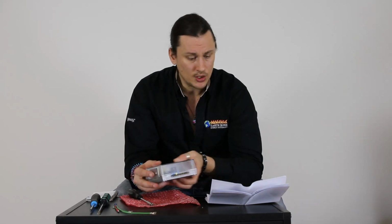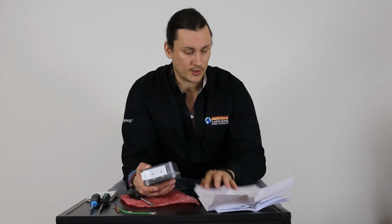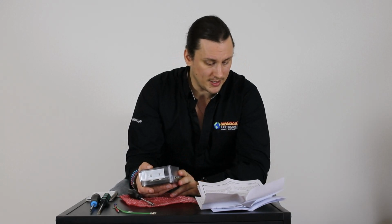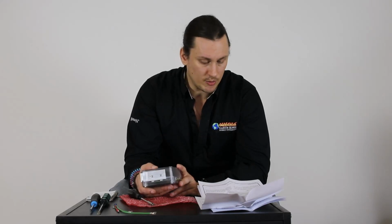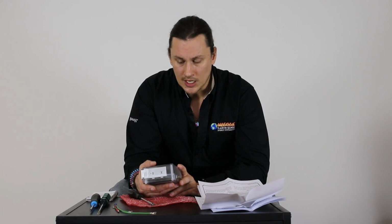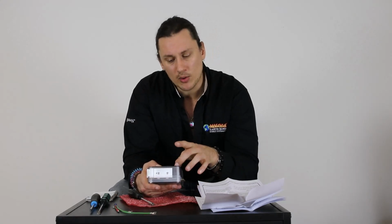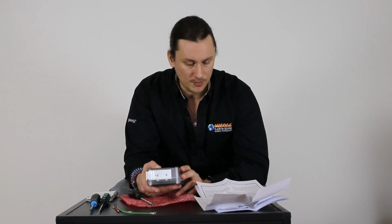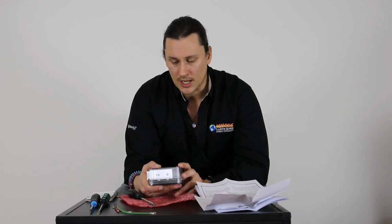The last thing that I wanted to mention here with the control board is going to be the blinking lights. So I'm just actually going to use this here for a reference. So our Thermocouple light. In the past, there would be a green and a red light that would run independently. With this newer style board here, that internal light will be green when the thermocouple has reached 200 degrees, and then that light will turn red once that thermocouple has reached 600 degrees. So it's just kind of a proof within the thermocouple right here of how that works compared to an existing board. And then the thermocouple light will actually turn an amber, and it'll flash 3 times if there's an issue, and repeat that process. So if there's an issue with the thermocouple, you're going to see an amber blink from that thermocouple light.